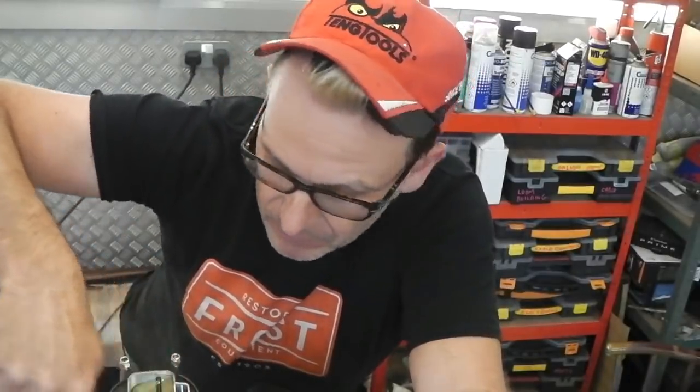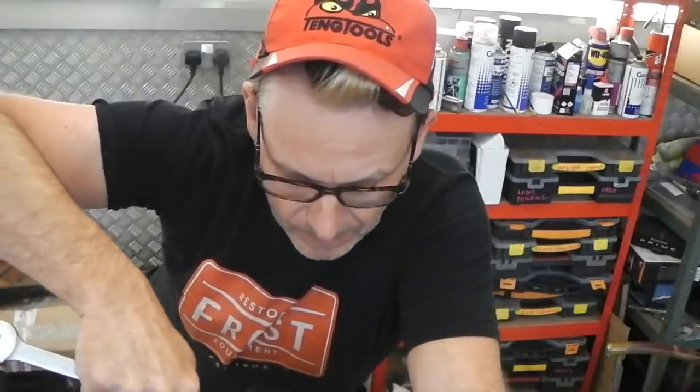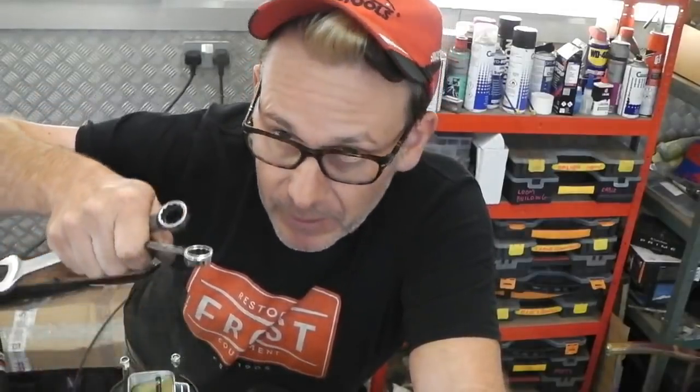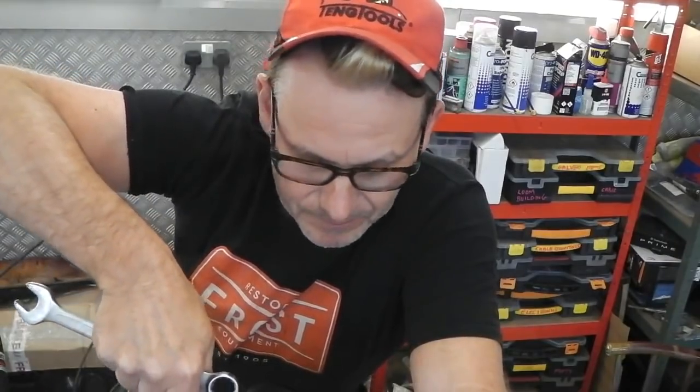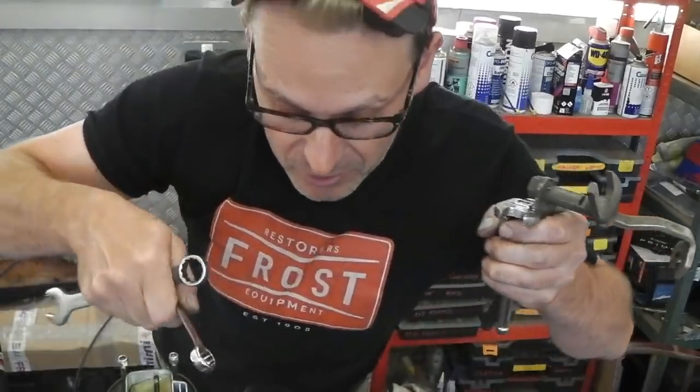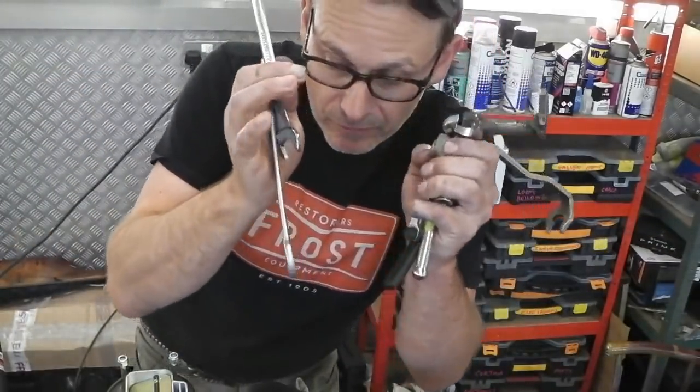We're going to rotate the crank round so that we get different positions on the camshaft, and we're going to be adjusting when the lobes are far away from the rocker. You can do two at a time. Always two land in a V shape. I'll show you that in a minute when we bring you overhead, but just running through the tools that you need.